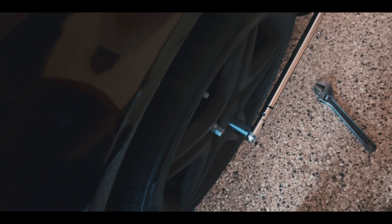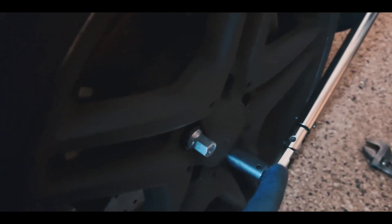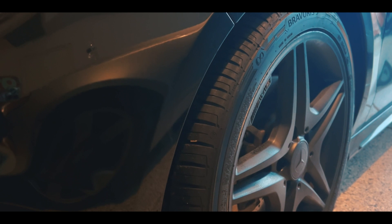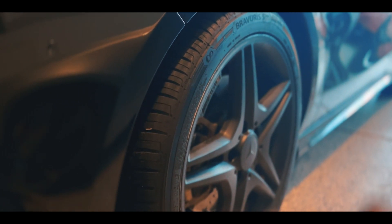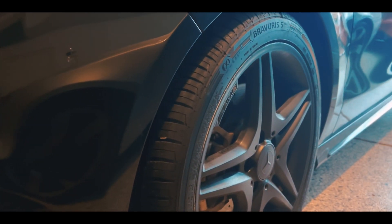You can do this on your own. Make sure both sides have almost identical marks on the bolt placement so when you go to the alignment shop, the car isn't too far off. As you can see, the tire is actually really straight now — it's out more than before. We're going to get it aligned. Thanks for hanging out — more projects to come on this car. Please subscribe, leave a like and comment. Camber kit for Mercedes-Benz CLA — I think all first-generation models are the same. Take care, God bless!